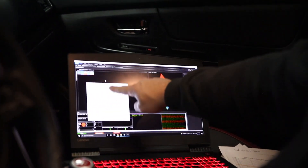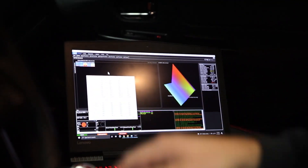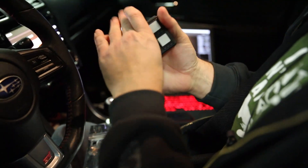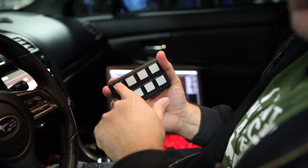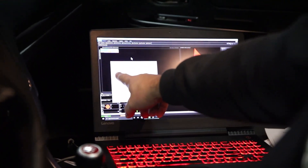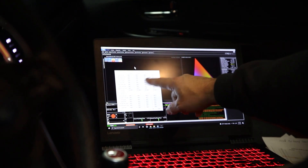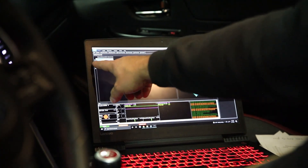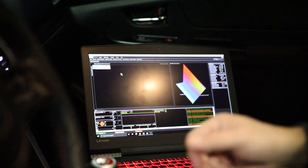You can see there are four slots that you can assign to something — whether it's your AC button, buttons on the dash, or a CAN pad like if you have an Emtron. The buttons have stickers to say what they're for. I can set this to be Cal slot one, two, three, or four, or even have it toggle between them and cycle through the Cal slots. In here you see fuel table, ignition table, drive-by-wire target, launch table, traction table — all that stuff separate for each Cal slot. For Cal slot control, I set the SI drive up here, and I also put the traction control switch so it reads the traction control button on the dash. By having traction control on or off, it switches which map it's in.